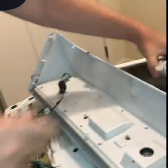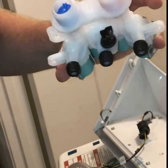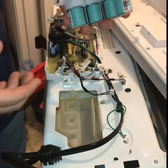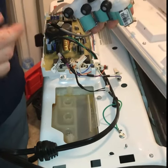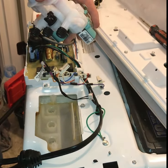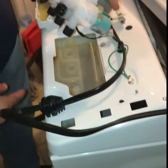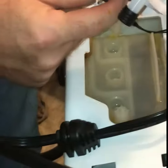There's our old one, and here's the new one - I got it online at Amazon for about $31, which is a lot cheaper than buying it anywhere else. I had to clean things up a bit because of the rusty water. The way I knew it was leaking here was I checked the hoses and they didn't leak, the outlet hose didn't leak, and I took the back off and saw nothing else leaking. But it would drip from under here and come out the side of the washing machine. I ran a load, got behind it, watched, and confirmed it was leaking from this area.